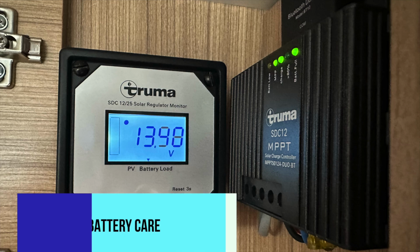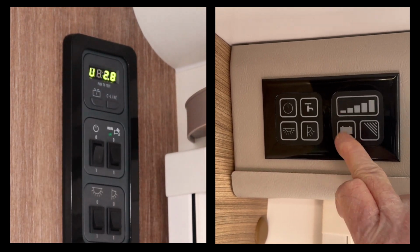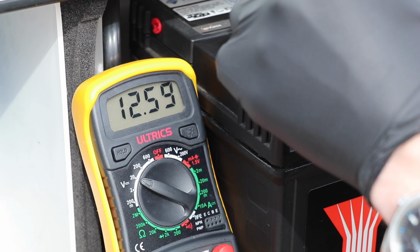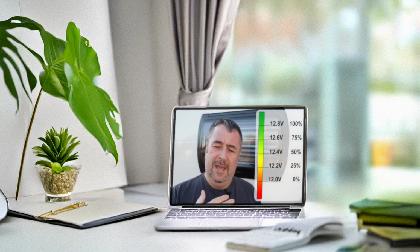The first task is something that you've already seen me do in this video, and that is to check the battery charge. Simply checking with your onboard voltmeter will work, or for better results, attaching a multimeter to the battery will tell us how charged the battery really is. Now, I created a video on battery care during the winter some time ago. Link to that is in the description below.